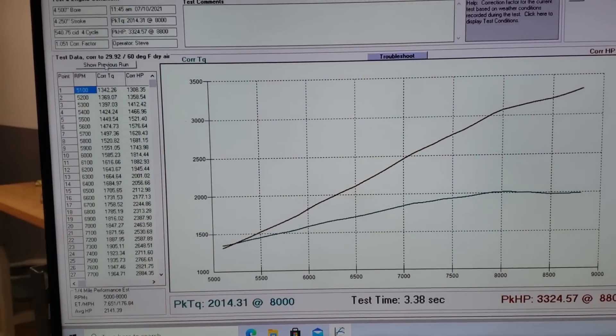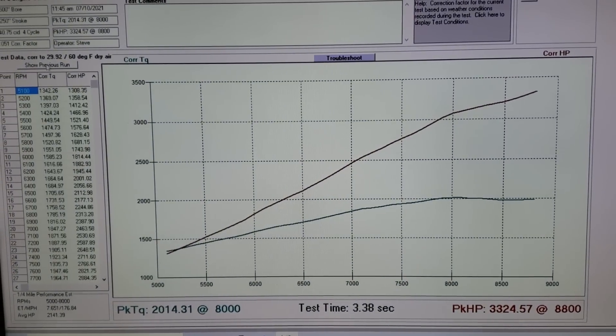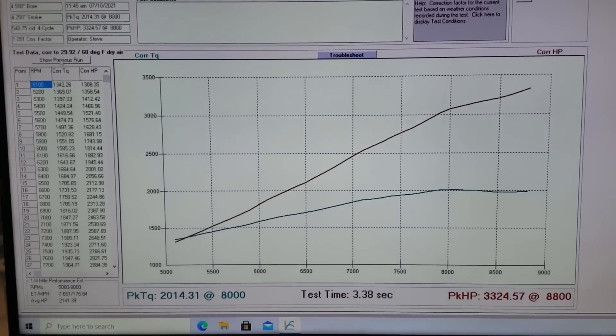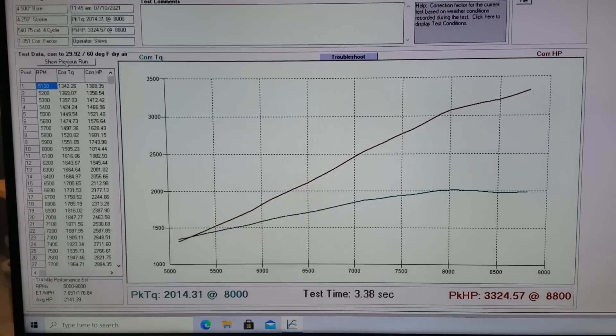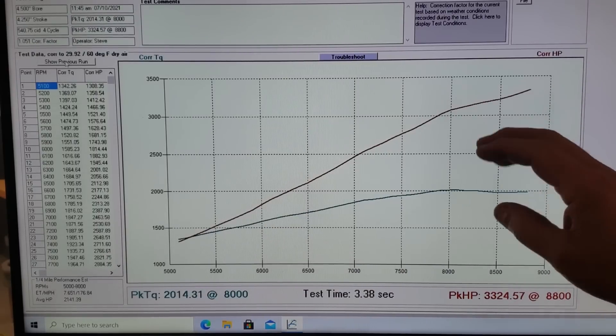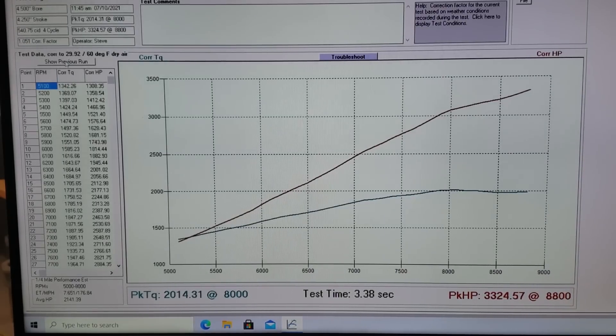For some reason I'm not sure why, but I've got to come back in it. Because you can for sure see on the data logger and the Holley that it goes to 9,000, but it doesn't get those last two numbers up here. I'm not sure if it's because I'm pulling back real quick or exactly why, but it only logs the last numbers recorded, and it's been doing this almost every time. I don't really want to run the thing above that — these things will run 9,500 RPM, but I kind of like them to be in that 9,000 and below range. That's a better place for them.